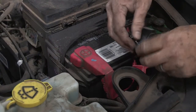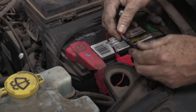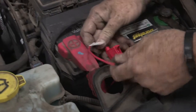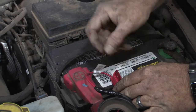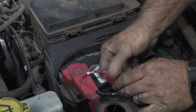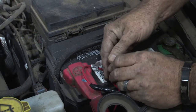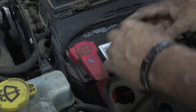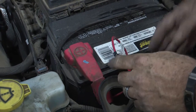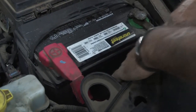We've got our connectors taped up. We'll take the provided 10 amp fuse and put it in the fuse holder. Now your 4-flat is powered and ready to tow. We'll put the cover over the fuse. Now we're going to go from front to back cleaning everything up — we want this to look really professional, so we'll take our time and use plenty of zip ties and tape if necessary.